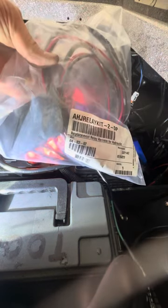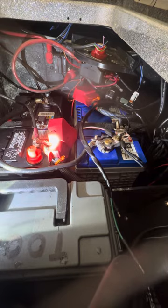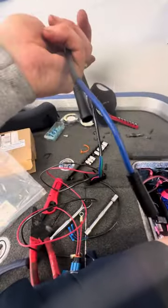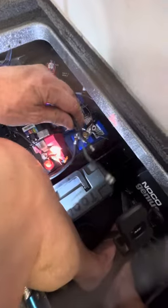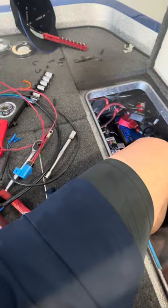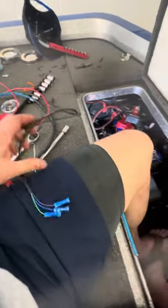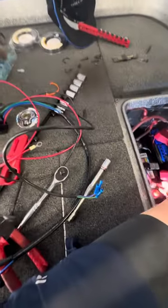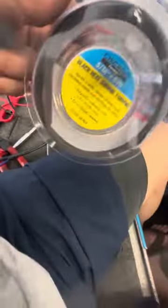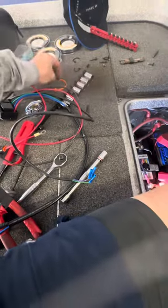So I've got my new pack. The green and blue will go to the motor connection I showed you back there - these are the female ends and the motor has the male ends. They're color coordinated for up and down. We've got our hot and it's already got the fuse relay built into it, but I'm going to have to cut this lug off because it goes to a switch on my Ranger. I'm going to cut off the existing terminals and use heat shrink butt connectors instead - that seals it. You could even put an additional heat shrink sheathing over it for added moisture protection.